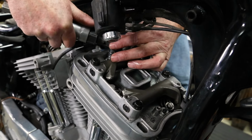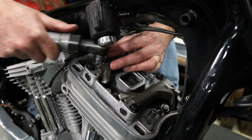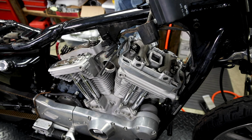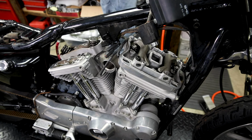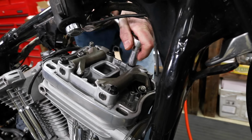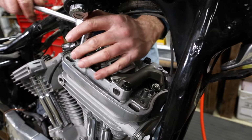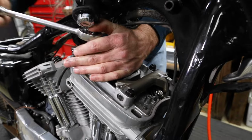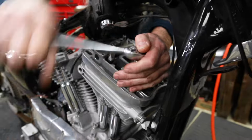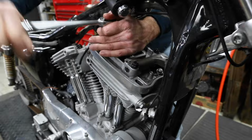And that one fell out just like the other one. Huh, imagine that. We are ready to loosen the other ones now. Really doesn't matter what order you do these in. Breaking the torque on them. Hear that? That's not to be alarming. And then if you ratchet them until they feel like they're loose, you can put the air on it.